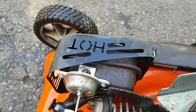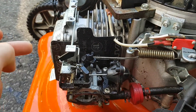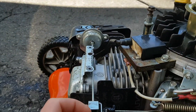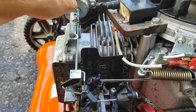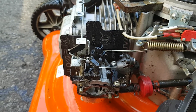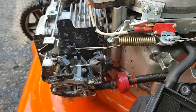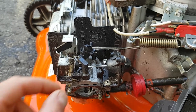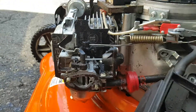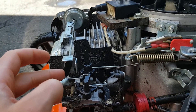The thermostatic coil is right on top of the exhaust, so it picks up all that heat and opens. It should be like that — if it's extremely flaccid and there's no spring to it, you need to change that piece. The diaphragm inside the vacuum pump doesn't really come in contact with any fuel, so nothing could really go bad in there. As long as it's doing its thing, you should be okay. In the cold state the choke plate should be closed, and once the engine is warm it should be open.